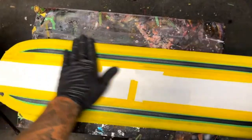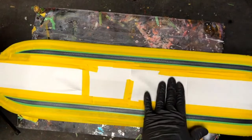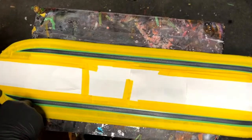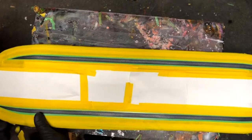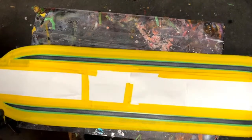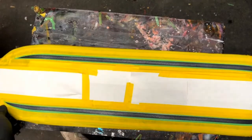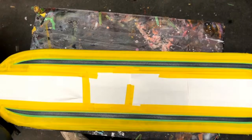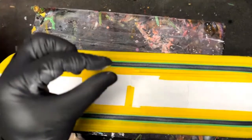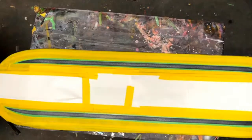Mils, meaning in thickness. Is a layer of clear coat, like if you have something with tighter tolerances mechanically, do you have to be mindful of how many layers of paint and clear you're laying? Oh yeah, 100%. That's where you can get up to like a mil of paint when it comes to custom paint. A mil's not even that thick, really. 3 mils is the thickness of a dime, if I remember right, and that's pretty thick. It will definitely mess with things if you have any kind of tolerance.